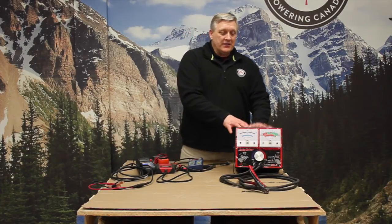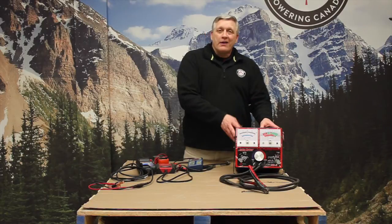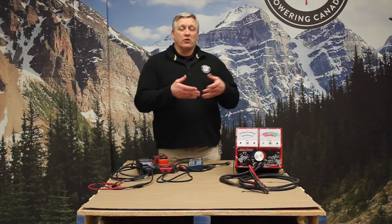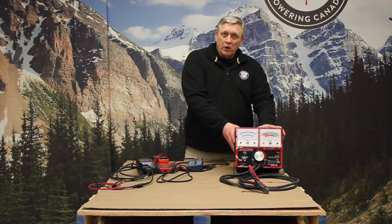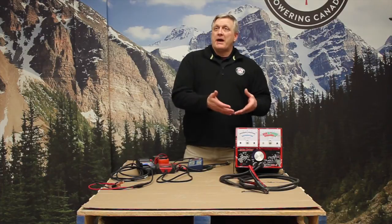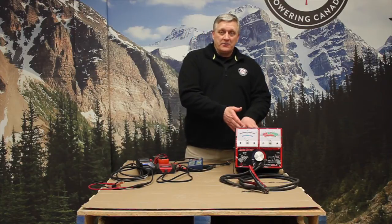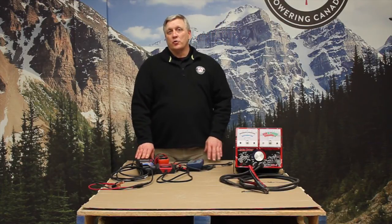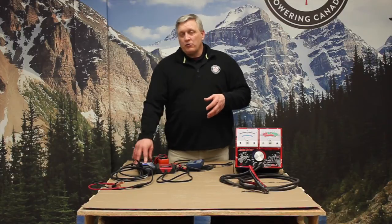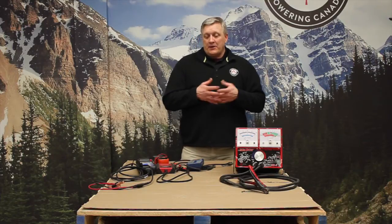The difference between this meter and the electronic meters is that you need to know how to run this unit. If a battery is not fully charged, it's not going to tell you that you need to recharge it before you test. So what we see often is somebody will load test a battery with a carbon pile load tester and it won't give good results. But if the battery isn't fully charged, you can't expect it to give you full amperage or what it's rated at — it needs to be charged first. Whereas the electronic tester will tell you that the battery needs to be charged.